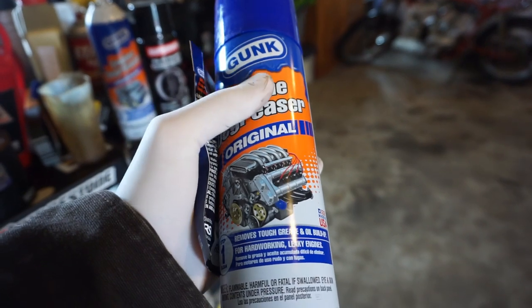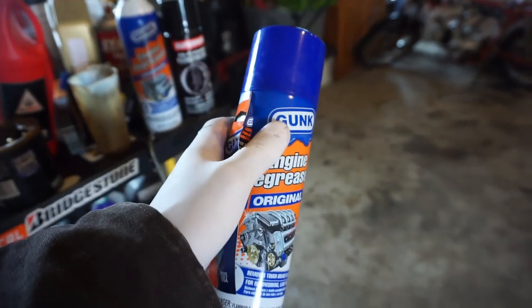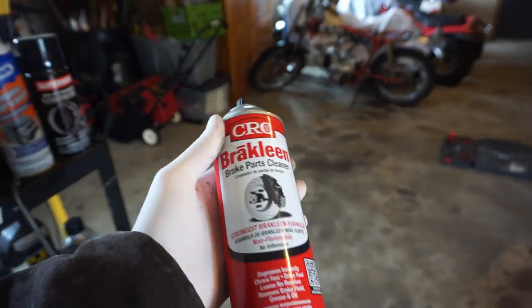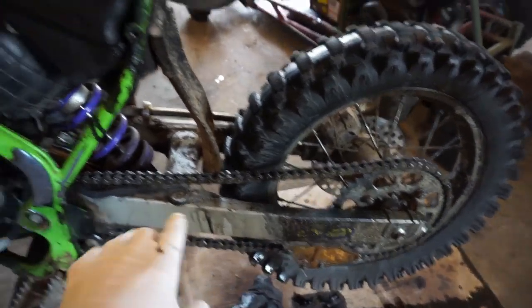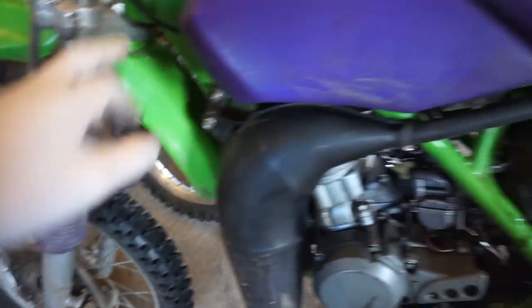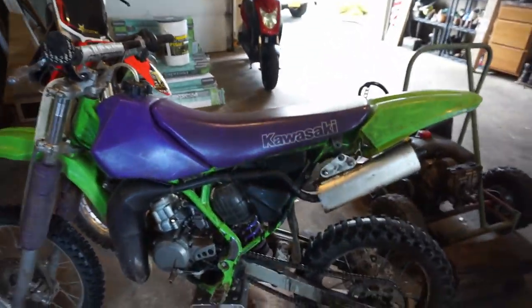Get the orange and blue kind — the other kind does not work that great. Not sponsored, Gunk works great. You can go on the plastics with brake cleaner — any type of brake cleaner — just to get off that extra residue. Use the engine degreaser all throughout the engine and on the swing arm. Use it on the plastics, the seat — see how the seat's kind of stained, it should take that right off too. It takes any type of grease off. Then I usually go over with WD-40 to get that shine when you take a picture.